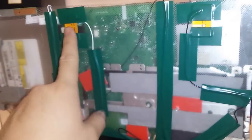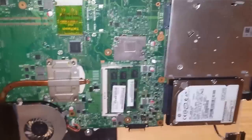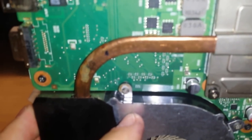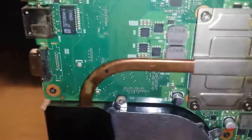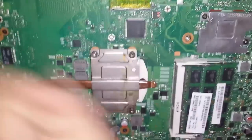It was pretty easy — these antennas were just stuck on the back behind the LCD. I undid them but there wasn't enough residual glue, so I ended up using some electrical tape. It ended up being cheaper to just do this than to repair the laptop. The screen alone was going to run me about a hundred-something dollars. It needed a new battery because this was actually water damage — you can tell on the copper there are all these stains from water damage. They literally dropped a cup of water on top of it. I was surprised the motherboard worked. I had to give it an alcohol bath, scrub it all down, put in new RAM because the RAM fried, and put new thermal paste on the processor because it was overheating.